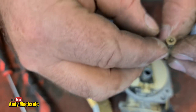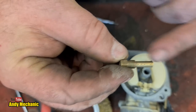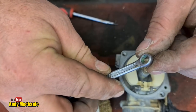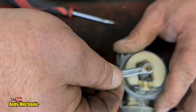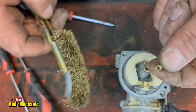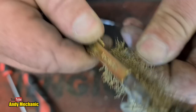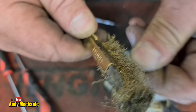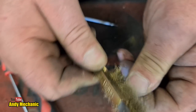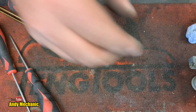The main emulsion tube — you can see it's clear down there. Some of the little holes were blocked as well but they're all clear now. Stick it in with the seven mil spanner. The main jet wasn't blocked, but there's still a little bit of green crusties in there so I'll give that a bit of a clean. This stuff was soaked for some time before I could get it cleaned out. One thing I do want to get is an ultrasonic cleaner for carburettors — never had one at home, really do need one.